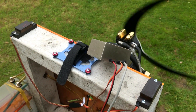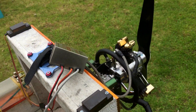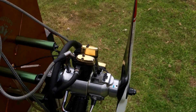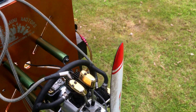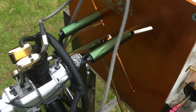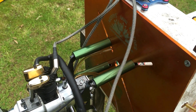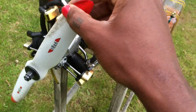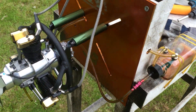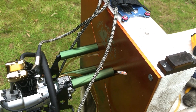So as you can see it's a totally different engine. It idles happily between 1100 and 1200 RPM, transitioning really well. The top RPM — the engine is brand new and this prop is an 18x6 — I'm seeing between 6600 and 6700 on the top end.